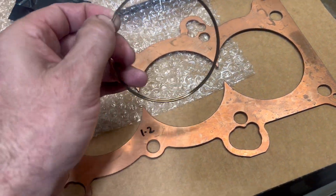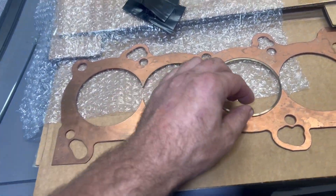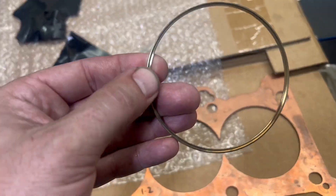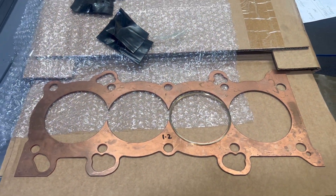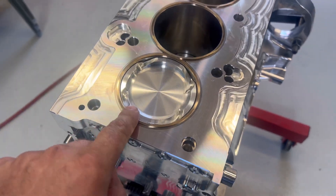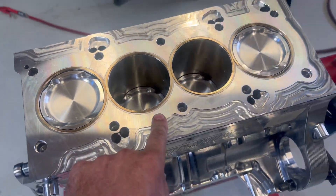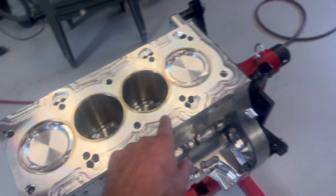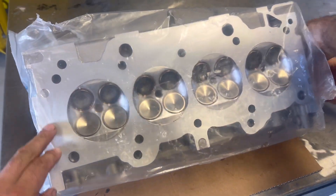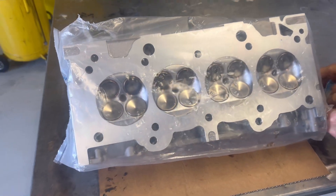Now this is going to be the best part about this whole engine — fire rings and a copper head gasket. So that gets us away from blowing head gaskets all the time. The system here is used on 2,000–3,000 horsepower cars and they seem to work really well. The beauty we have is that even if combustion gases do get past this ring, there's no water galleries here for those gases to go into, so we're not going to have any coolant pressure issues. The bottom of the head has also been welded up — all the holes welded and remachined, valves recut — so no gases can find their way into the cooling system through the head gasket.